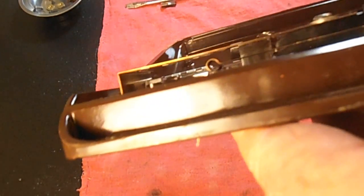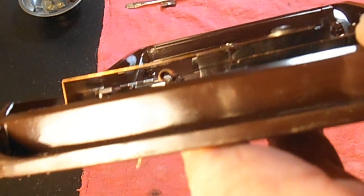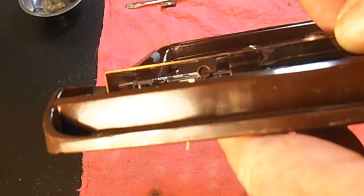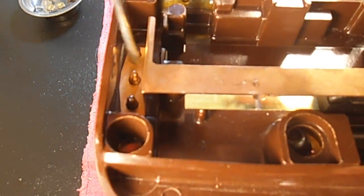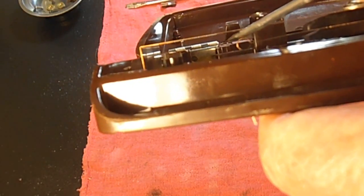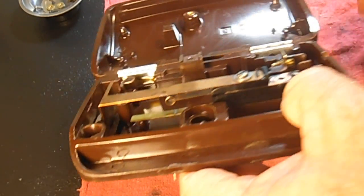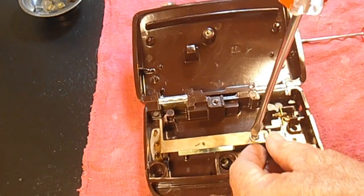So you want to be sure when you tighten up the fastening screw and washer that that little shoe is about in the middle of the adjustment area, and this is nice and flat on the 3 posts, and that there is a gap between the little curly Q of the contact spring and the actuating spring. Once you got it set like that, you can just go ahead and tighten it down.